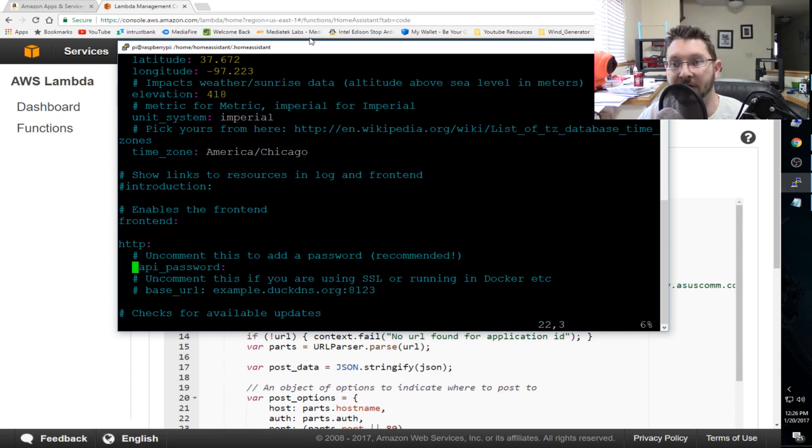What happens, just as a brief networking lingo here, you have what's called NAT, or Network Address Translation, that's on your router, if you're running a router. Now, if you're not running a router, if you're directly connected to your modem, then whatever IP address your computer has is the address the ISP gives you. But if you're behind a router, it does Network Address Translation, or generally it should. So what that means is it takes the IP address that's on the inside, which is like your computer, the 192.168, whatever, yada, yada, yada. It takes that address and translates it to that one single address that your ISP gives you.